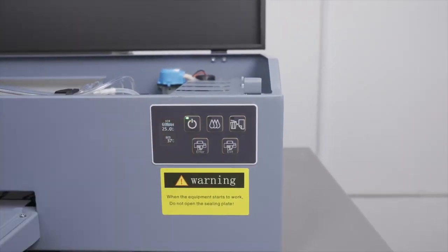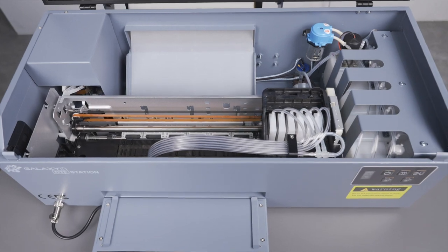At this time, check if you see any red lights on the trash and/or ink buttons. This may indicate that the cartridge lock was not removed or there is some type of obstruction in the printhead carriage area. If you can't find the obstruction, contact support.